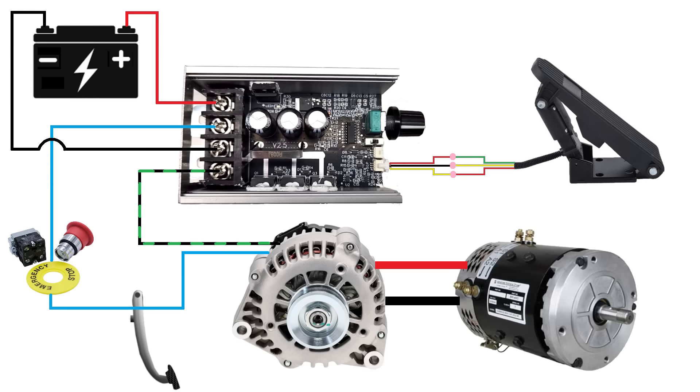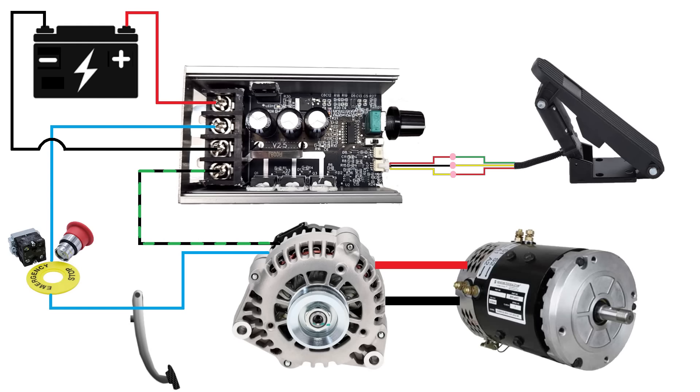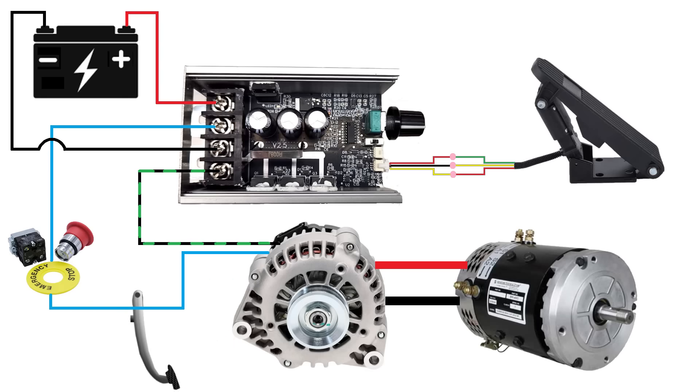To get the golf cart to move, just press down on this drive-by-wire accelerator pedal, and that'll get this little $12 PWM power supply to feed voltage to the field coils on the alternator. At that point, the alternator is going to start generating a massive amount of power to feed to the electric motor. We do have a little battery in the system to power the electronics, and we recently developed a way to keep it charged. Mixing cheap electronics with a semi-powerful mechanical system can be very dangerous, so we also have an emergency stop button to cut the feed to the alternator, and another cutout switch connected to the brake pedal as a secondary emergency stop. These safety devices are absolutely necessary.